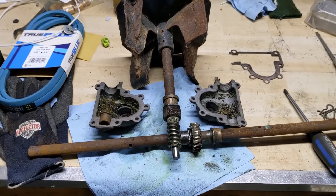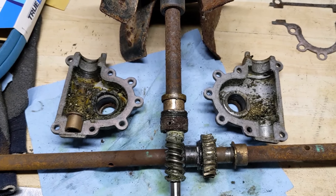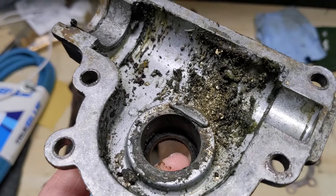But as you read in the title, why you should check to make sure your snowblower's gearbox has proper lubrication — check this out guys, this thing is pretty much bone dry. There's nothing in it.